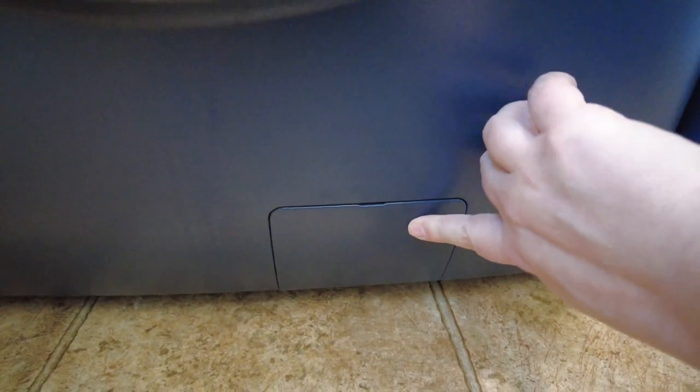The biggest tip I can give you is to tackle something that we never knew existed on our washing machine. This one thing was causing all of our clothes to have a sour smell after they dried. It's that funky odor that you can sometimes have after letting wet clothes sit in a washing machine for too long. But in our case, we would still have that smell even if we immediately removed the clothes from the washer to the dryer, so we were really confused. It turns out that if you have a front-load washing machine, there's a drain pump filter that needs to be cleaned out regularly. We had no idea that this was even there, and slowly over time it became a bigger and bigger problem for our clothes.